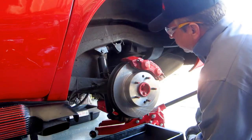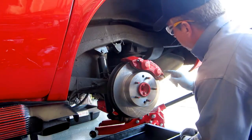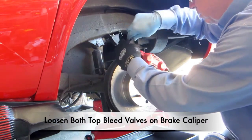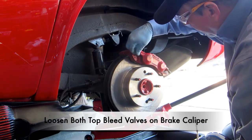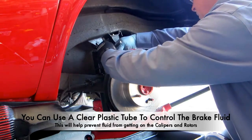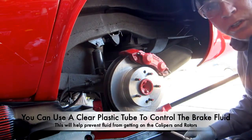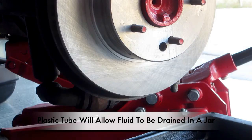This car actually has three valves — one here, one in the rear, and one here. This one we're not going to worry about. These two are where air will escape. So we'll loosen this valve and let the fluid drain out, and this valve and let the fluid drain out. The fluid will simply drain out here into the pan, and all the air will escape. Notice how the brake fluid is escaping out — along with the brake fluid is also the air out of the system. The gravity is just forcing it out all on its own.